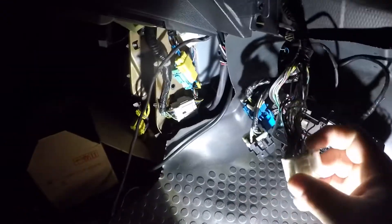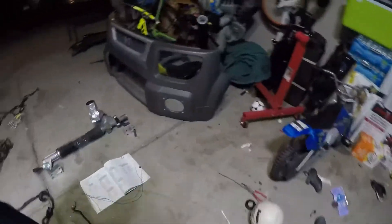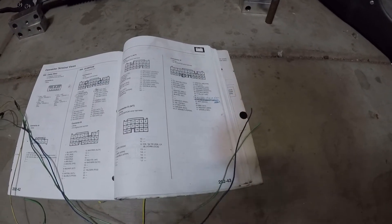This is the other connector sitting inside the car. On the back side of this connector, that's the pin you'll need for engine RPM. Those are the only three wires you technically need to get this up and running. I highly suggest you solder your joints, or pull back the wire and crimp directly — do not use T-taps. T-taps did not work for me. I had a huge problem with the engine RPM signal not being seen — it turned out to just be a bad connection from the T-tap.